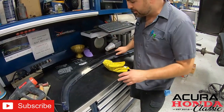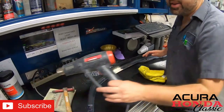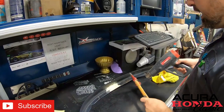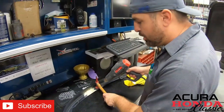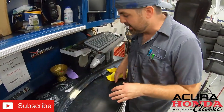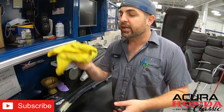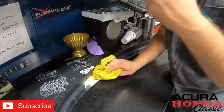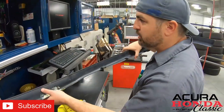I noticed it's a little bit off, so I'm going to show some quick tips to even out the plastic. We want to test fit it first — I don't want to put all this time and energy in, get it back on the car, and have it wobbly and wavy. If you have a lip that's a little messed up underneath, what you can do is use a heat gun — this is just a Harbor Freight $7 gun. Heat it up completely, then use a flat hammer — you're not going to hit it, just hold it, heat it for a few minutes, and massage it back into place. Then grab a rag with cold water, and as soon as you're done heating and shaping it, hold it there for just a few moments and that's going to freeze the plastic in its spot.